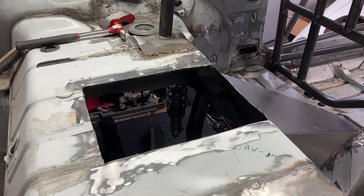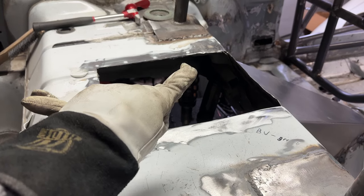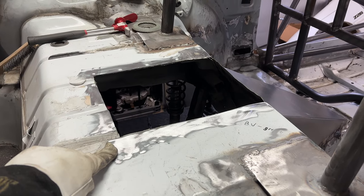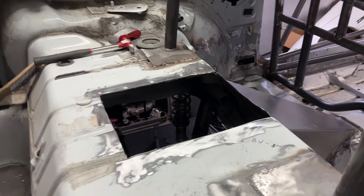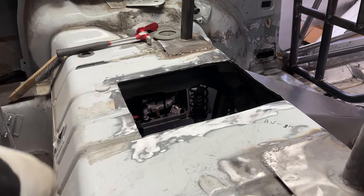I've been working on cleaning up this hole here, getting everything kind of cleaned up and straightened out. I had to weld up some spots over there where I'd cut through. This is like the fuel tank access hole — the trap door they call it — so trying to weld this back up, and then I'll recoat it since there's no fuel tank down there anymore.